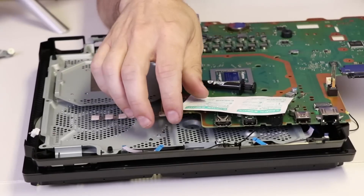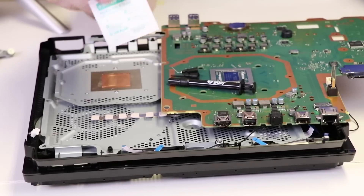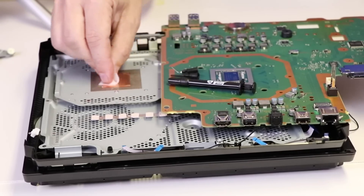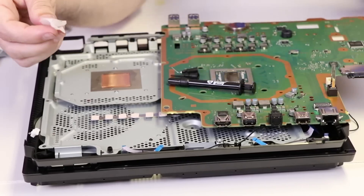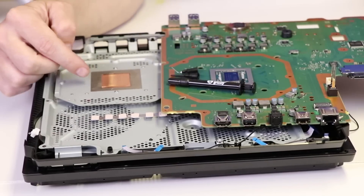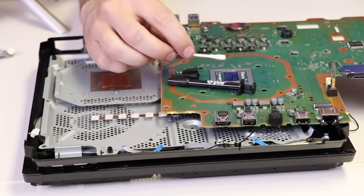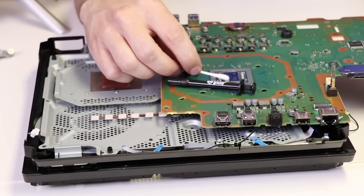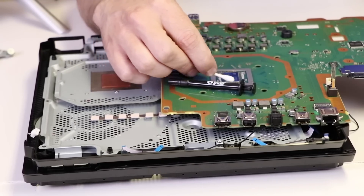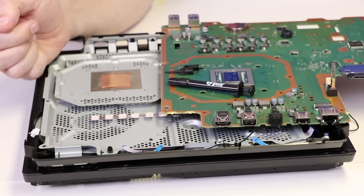Step number one: clean the surface. They include two alcohol prep pads that contain 70% isopropyl alcohol, so we will use one of those now. Unless yours is extremely dirty, I see no reason to use both of them, as both surfaces need to be completely dry. I'm actually going to use a cotton swab to get the surfaces completely dry, as there was a lot of liquid in those. So we're going to make sure these are completely dry. Now we have a dry heat sink and a dry APU so we can proceed with applying the thermal paste.